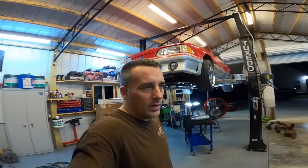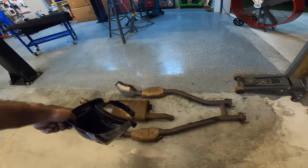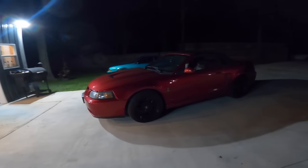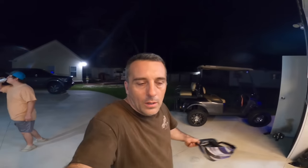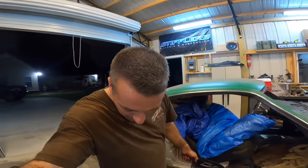I don't care if you're in the driveway, I don't care if you're in the gravel — it doesn't matter. Stuff you can do yourself, you don't have to always take your car somewhere and pay somebody. Today we took the old stock H-pipe off Hunter's car and put a new Bassani on it. Took us about six hours to do but we got it done. We had some issues with the nut on the passenger side. We literally had to weld a nut to the stud because it broke, then ended up grinding it all off and welding a whole new stud on. The point is — get out there and do something. Don't be lazy like Hunter.